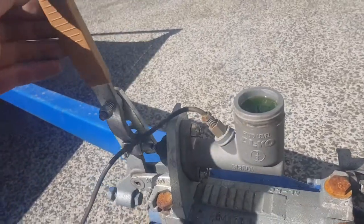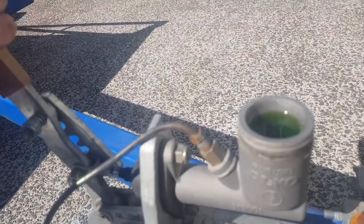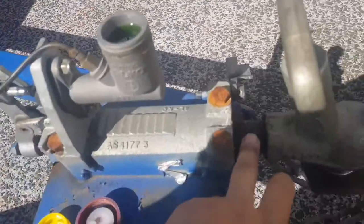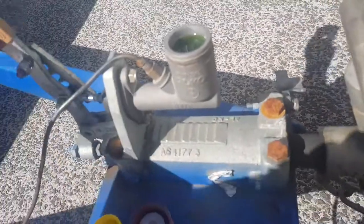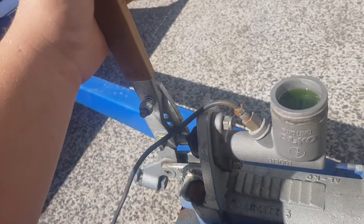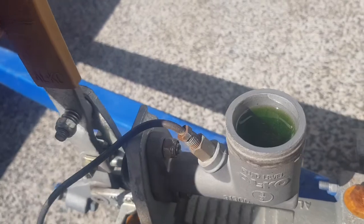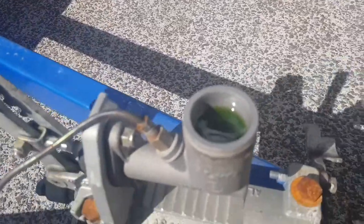It's going to suck it into the pump. It's pulling the air out of the system — you see the bubbles? I'm also going to lubricate this slide here because it looks like it hasn't been done for a long time. It's been moving because that was bent and it wouldn't go in there. See the fluid level drop? Every time we do that it gets a little bit firmer.